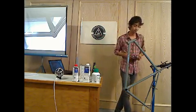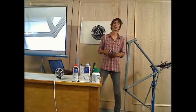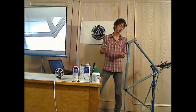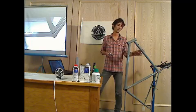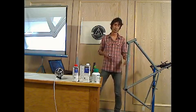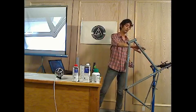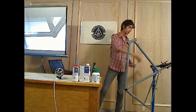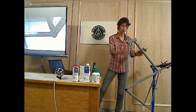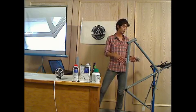Well, at different stages, it's different. For primer, you don't really care, because afterwards you can just sand it if you have to. Normally you don't want to, but you can easily sand that down, any drips or runs. Usually you're going to sand down the primer anyway, because of any little dust particles, so it's nice and smooth for the color.